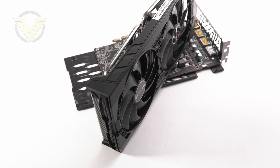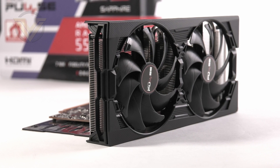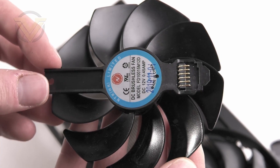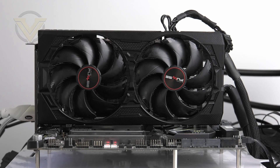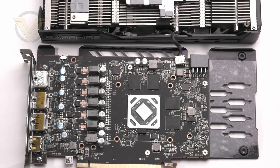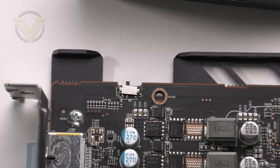We've taken the cooler off for a closer look. There are two 95mm double ball bearing fans which, like other Sapphire cards, are quick-connect ready — removable with a single screw for easier maintenance or fan swaps. Those fans also use zero decibel technology, so they stop spinning when you're not gaming. Both fans sit on a large one-piece heatsink with triple copper heat pipes. VRM and VRAM heat is distributed via the heatsink, with a copper base plate in the center for the GPU. One thing we noticed is that some components appear to have been soldered at a slight angle — not quite straight — and while this doesn't affect performance, we'd like to see more care taken with construction.